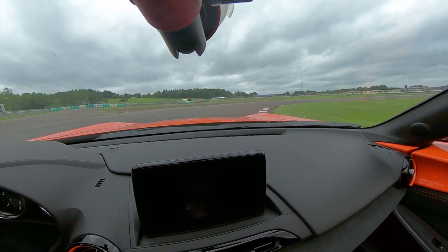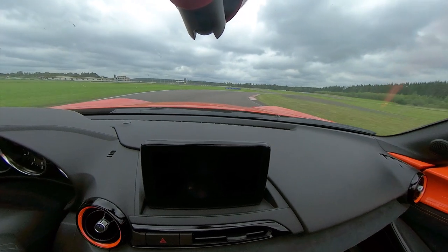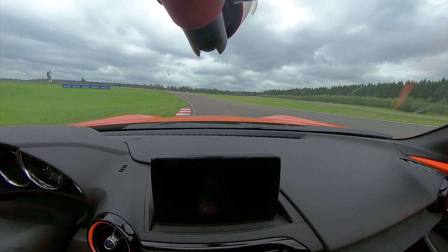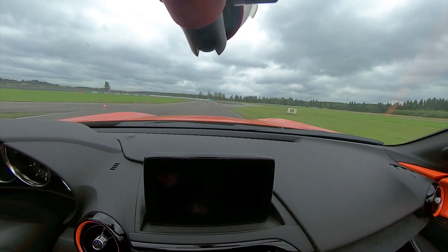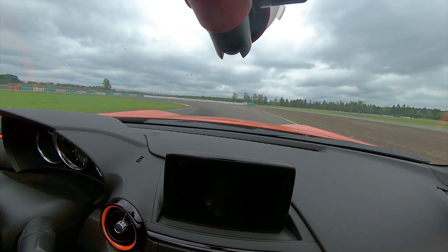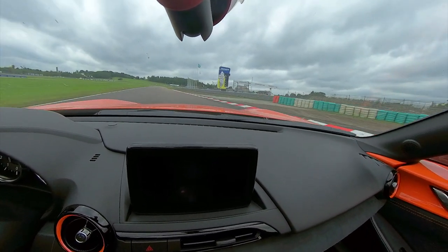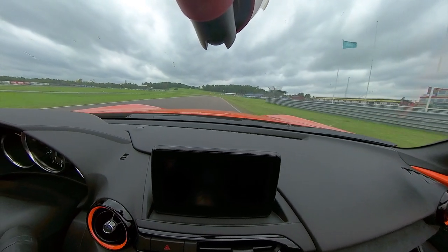However, I was fully caught by surprise in the moment when I went off the track. It was like I almost lost all of the brake force, and the pedal became very, very soft. I think the previous stress on the brakes, and also me braking maybe ever so slightly later than usual in this particular corner, tipped the scale. Thankfully the barriers were a distance away from the track itself and the gravel caught us, and we didn't damage anything, we didn't get any paint damage, etc.